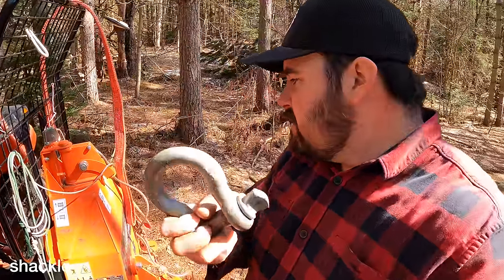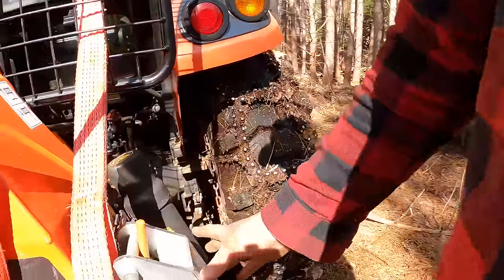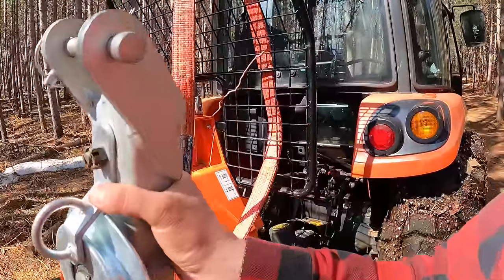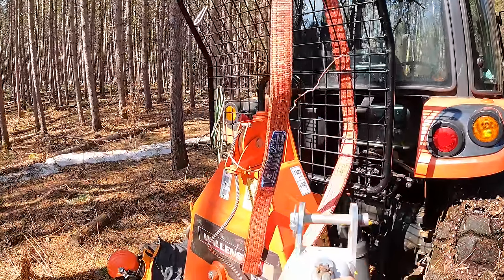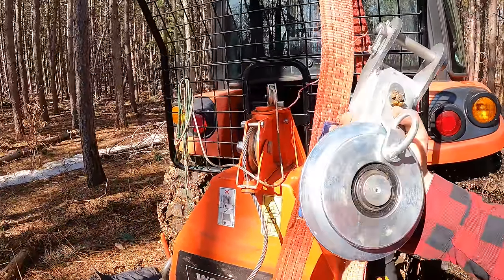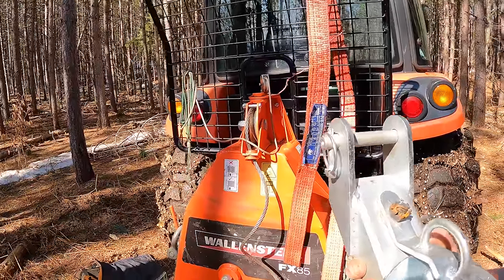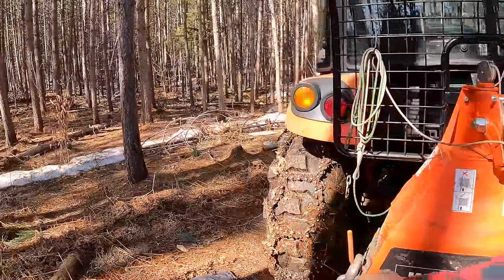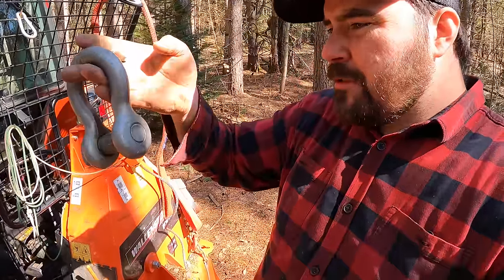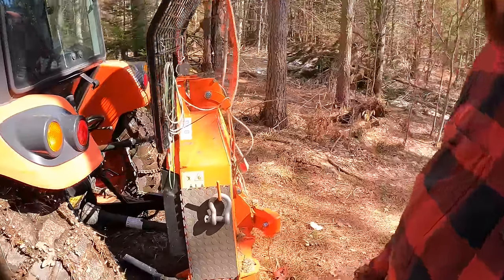If you have one or two of these, they'll come in handy especially when hooking up your snatch block or pulley. This one in particular allows the pin to come out of the top, so you don't need any extra rigging — the strap just goes around a tree and does its thing. If you didn't have that style, you'd need a shackle. Get a few of these and make sure the rating far exceeds the forces you think your winch will apply.